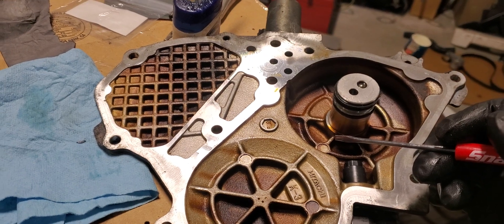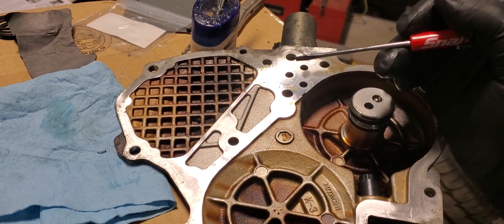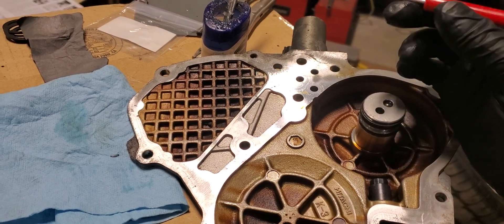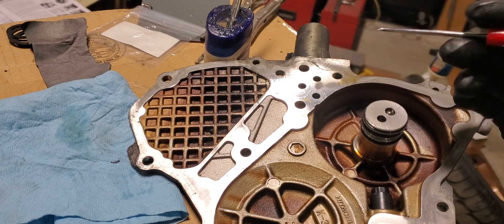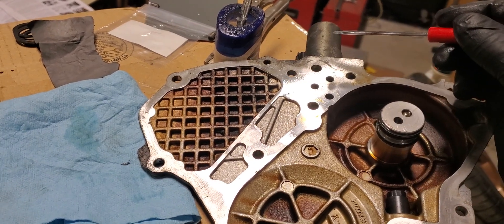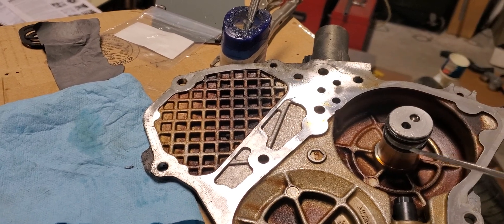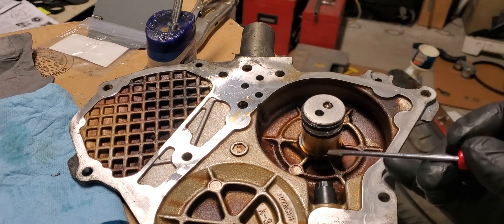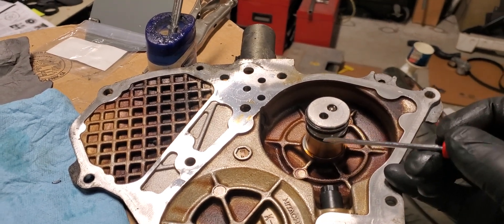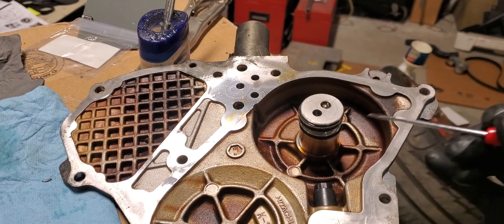The actual hydraulic lockup of the cam is reliant on the oil passage that goes from the front timing cover, then goes through this cover, and via the solenoid is then going to actuate the oil that goes through an internal passage and comes into this guy. Why I'm saying these three seals are super critical is because that's what's allowing the intake cam to hydraulically lock up.